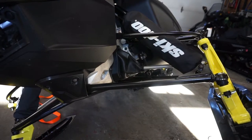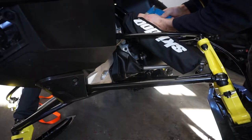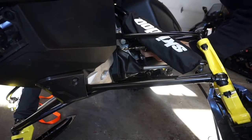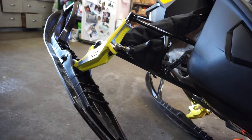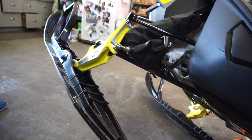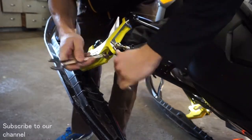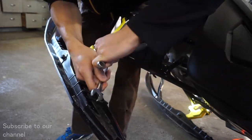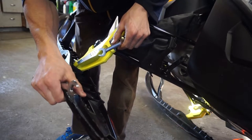Here's a time-lapse of me drilling all the rivets out. Now we're gonna remove this here. You're gonna need a 5/8 wrench and a 1/2-inch wrench as well. You're gonna have to put the half-inch wrench under the ball joint here. You have to hold your ski because the control arm wants to move now.